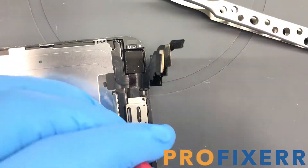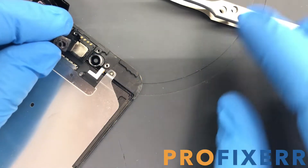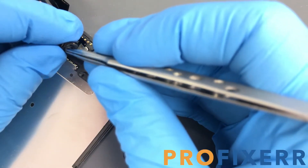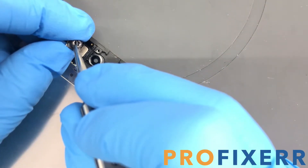What you'll do is go ahead and take off the screws that are holding the ear speaker bracket, and once you flip the camera over you'll see that circular gasket sitting sideways — halfway across the camera. Then just get some tweezers and carefully remove it, grabbing a loose edge.